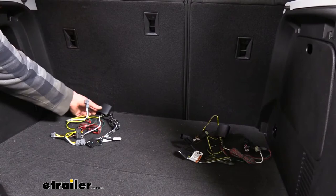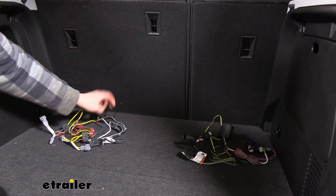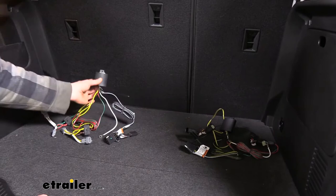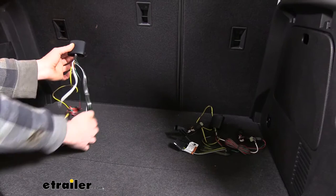They'll both be module protected. We'll have a module here, and it will use these connectors to monitor the outputs from your vehicle. It will then produce its own lighting signal for your trailer on the four-pole connector. What's nice about that is that if we have any faults on our trailer, it's not going to affect any of the wiring on our vehicle. The module will then shut that down because it's monitoring the outputs here. Or in the event that it's unable to shut it down in time, we have a dedicated power circuit for our module, and this is what's producing the signals going to our trailer.